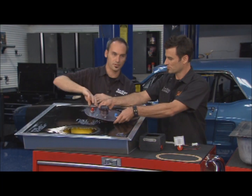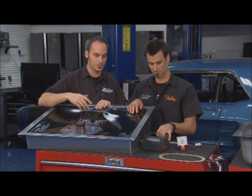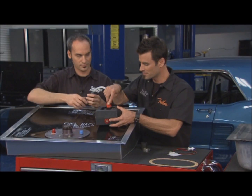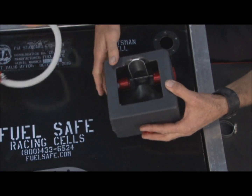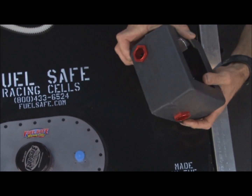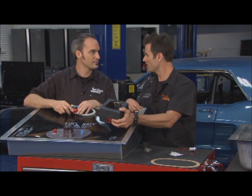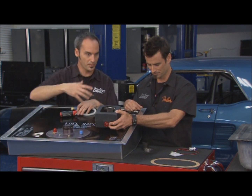There's a check ball in here too. So if you roll over — imagine that — the splash guard seals this off and the vent seals this off. Now here's where the pump resides. Check out this little box — the pump goes down inside and this is going to keep fuel inside. If you flip it left, you see this little check ball — it's a little nylon ball. As you turn it left, it lets gas into the box where the pump is. You turn it right, it locks it off and keeps the fuel from going out. This whole assembly drops straight down through this big opening, right where the fuel is.